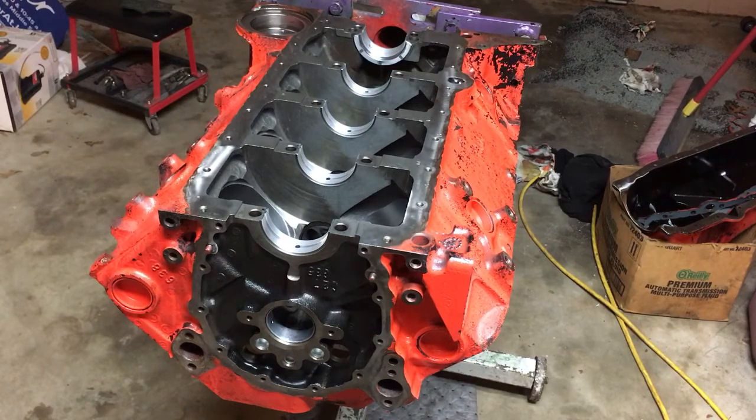Because I've mentioned in at least one of my videos, no matter how clean something looks, don't trust it. If you didn't personally wash it, wash it. Even if you go to the most reputable machine shop in the world, I'm not talking down on anybody's business, I promise you. But when you pick up a block and they have it sealed in plastic and they say, yeah man, it's ready to assemble, wash it. No matter how they cleaned it, they're not going to do as thorough of a job as you will. I've said that more times over my lifetime than I could count.